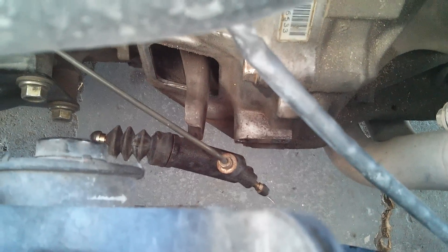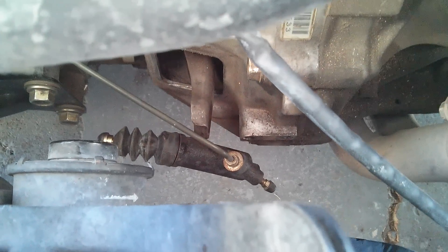So you have space to remove the slave cylinder from the fork. You want to lube in here where the ball touches the slave cylinder — just put a bead of high-temperature grease, and that'll take away the squeaky sound when you depress the clutch. Alright guys, thank you.